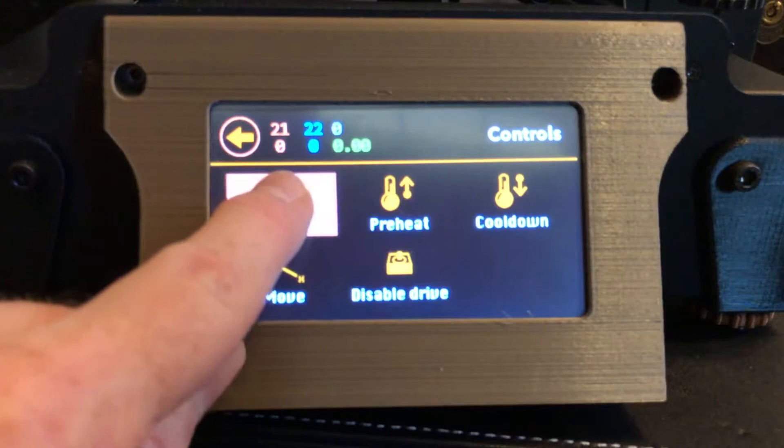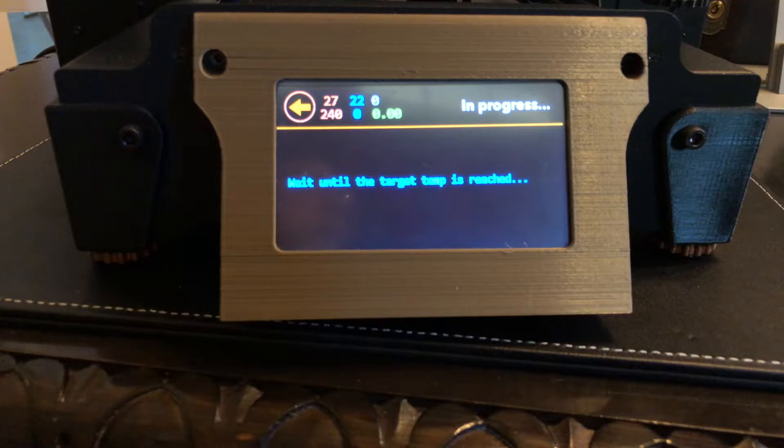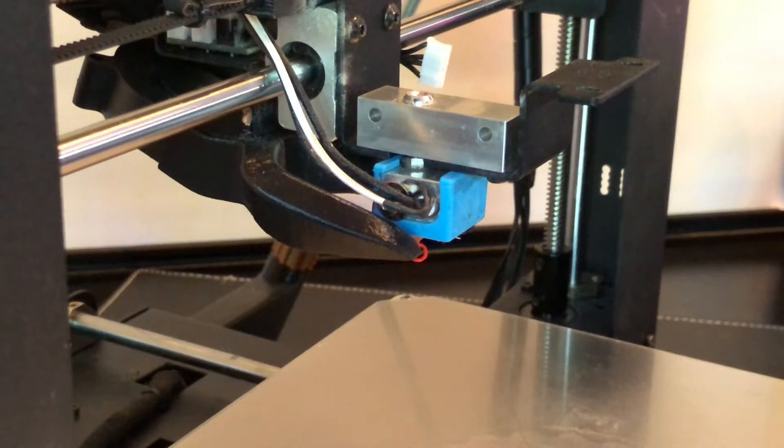We'll use the filament load/unload feature because that heats the nozzle without heating up the bed. Again, this is going to get hot, so be extra careful not to burn yourself. I'm using the ADVi3++ firmware on this printer — if you haven't installed it, I highly recommend it; there's a link in the description. I've set the nozzle to 240°C, which is going to get plenty hot. Because the fan and heat sink are no longer attached to the cooling block, that's going to warm up too — that's actually the reason we removed them. Also be careful around the rest of the metal here, like the bracket where the stock parts cooling fan mounts, as all this metal will be soaking up heat. Once up to temperature, let it sit for a few minutes so heat can get up into the tube connecting the heater block with the cooling block.